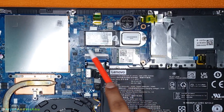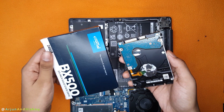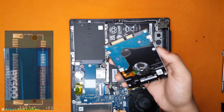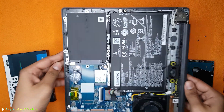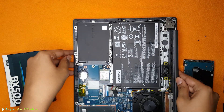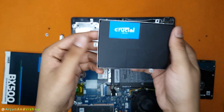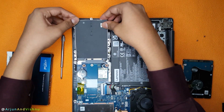The laptop equipped with the SSD would not need any more upgrades, but the model with the 1TB hard disk needs an SSD — this is compulsory for speed. We are left with no choice but to use a SATA SSD because of the lack of an M.2 NVMe slot. Hard disks read at around 100 Mbps whereas SATA SSDs do 500 Mbps. Lenovo has secured the HDD bay screw with a tiny sticker — carefully remove the sticker, remove the screws, and replace the HDD with an SSD. Put the sticker back on the screw just in case Lenovo considers it important for the warranty. With this upgrade, your disk performance is 5 times faster.